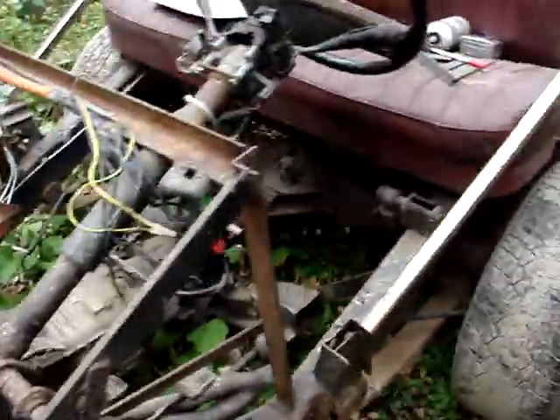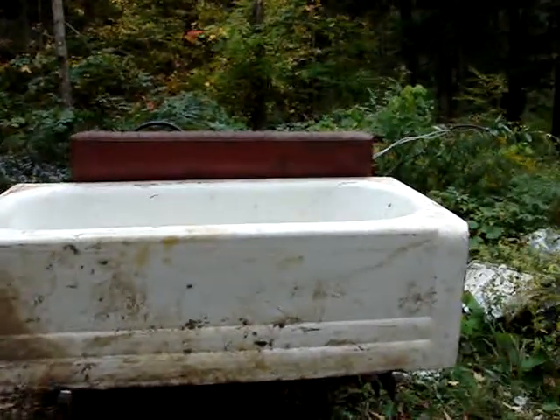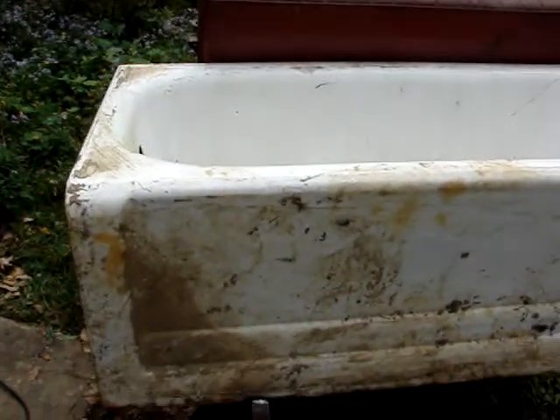Anyway, that's where that's at, but the tub is mounted on the back of it. It's a little bit farther to the left — I realized people are going to say it's not in the center. It's that way on purpose, because that hole would be right over the frame if it was in the center, and that'll never do. So it had to be shifted this way a little bit so that I got clearance for the drain hole. It makes the suspension work anyway — that's a heavy tub, being cast iron like that.